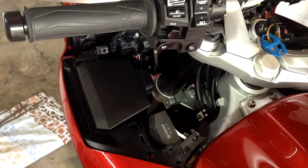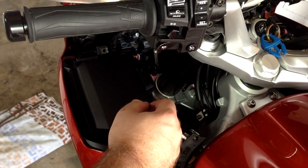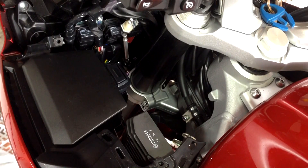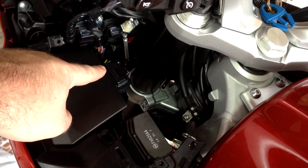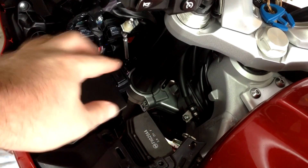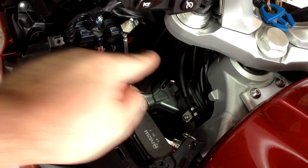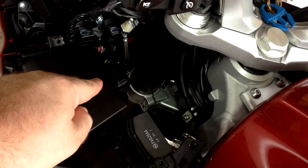So now let's go ahead and start the swap. The first step is to take out the headlights — I'm going to do one at a time so I can get you a really cool demo at the end of the video. These wires right there, the green and yellow, are going to the headlight connector. It's a three-prong connector and it just pulls straight back. It's pretty flimsy plastic, so when you grab it, grab it from the sides.